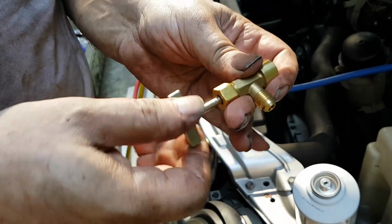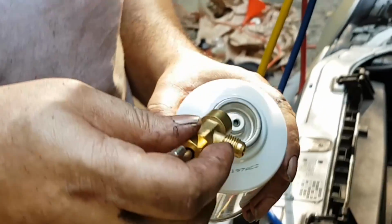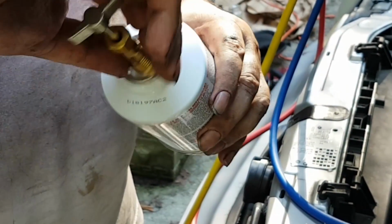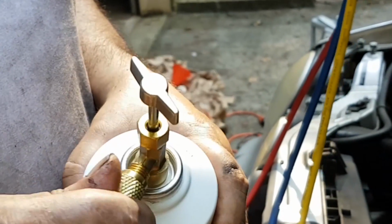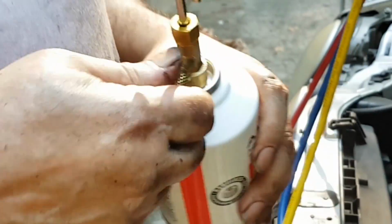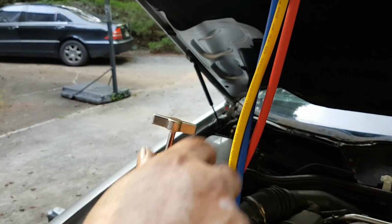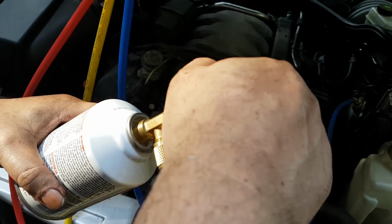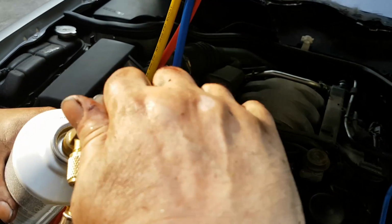I've included the numbers for the W210 and W220 with front only or front and rear air conditioning. Here's the tap. The gauge I reference in the description comes with a can tap, and the mechanism works in such a way that you turn the knob on the tap and that pierces the can, and then you'll wait to hear a hissing sound. That means that now Freon is making it out of the can into the yellow line, and then you back it off a little bit, and so that means that Freon is now making it from the yellow line all the way into the gauge.